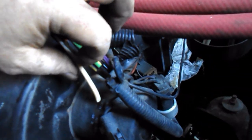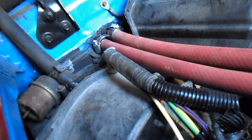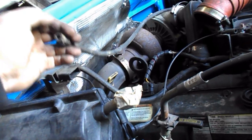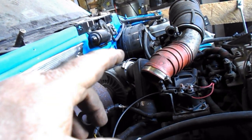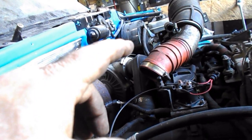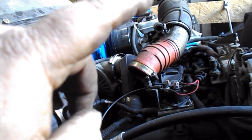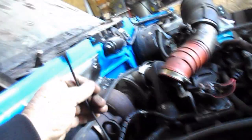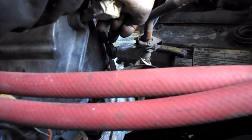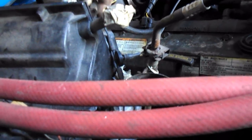I dug out the end that was broken — a plastic vacuum line that goes back to this canister valve, which I've got to get a piece of hose for. Figured out that this end, the vacuum hose which goes over to a splitter multi-T, has a supply hose that comes from the vacuum pump and hooks to it. This hose hooks to this, and I've got to get another check valve joint to go between this and this — and that's figured out.